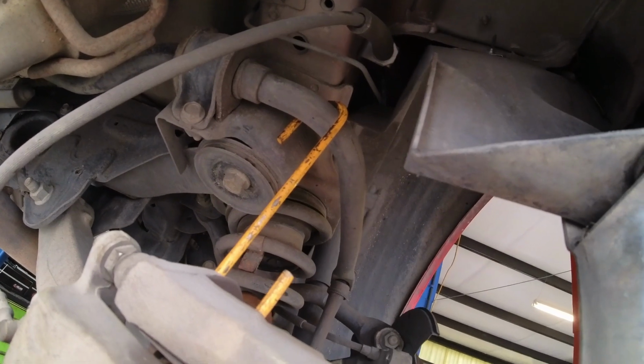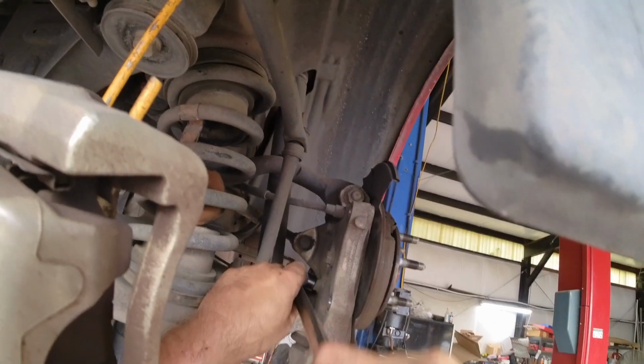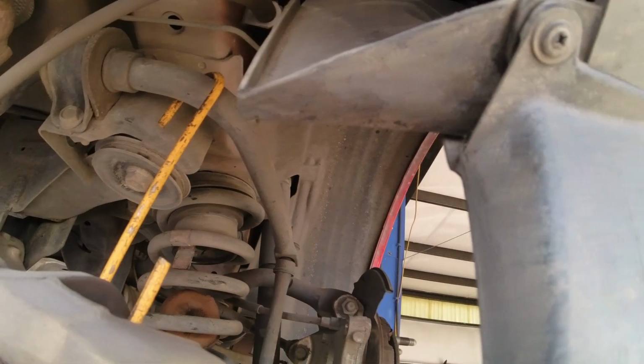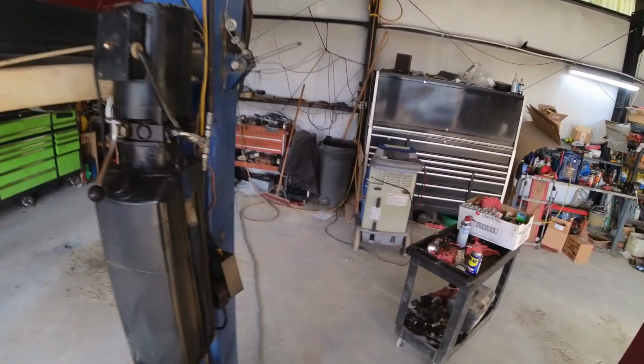Yeah, sorry, this is not the perfect camera angle. The camera was slightly too high, and sorry for that. But if there's anything crucial, I narrow it down. Basically all the rear screws, the bolts, are all 18. You can use a breaker bar to break them loose, or if you have a long 18mm wrench, that works fine too. And then just ratchet them out, or if you have a swivel tool, then of course that makes it easier to speed this up.